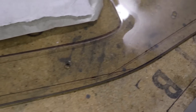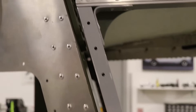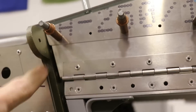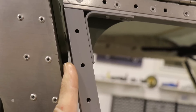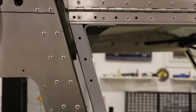You can see here where I've drawn the lines. On the back side, there's a little joggle, and I'll show you why. That's where the door glass goes around the aft wing mount. I want the door to fit right back here, but then it has to come in a little bit and then up — that's why I have that little joggle.